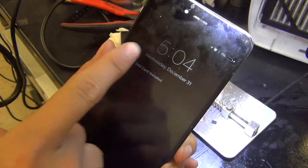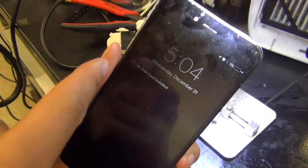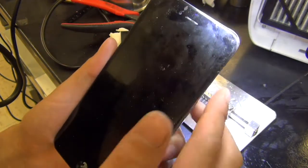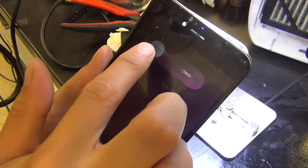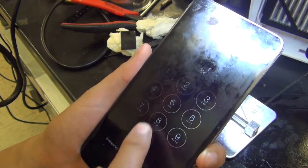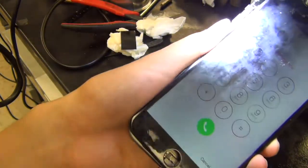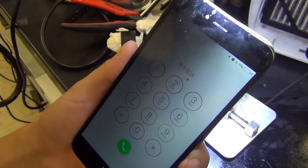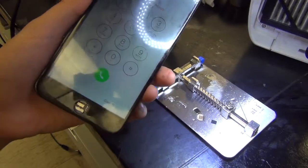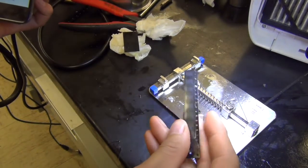By the way, the screen is a little bit dark on the side because this is my test screen — I use it so much I blew out one of the LEDs on the screen itself, not the board. So that's a non-issue with the actual phone screen, which is why it became my touch test screen. As you can see there are no lines on the screen anymore. There's no Z-bar line — and Z-bar line is a telltale sign of a touch screen problem. You can buy the touch IC for iPhone 6 Plus and 6 on my website as well. Thank you for watching — see you in my next repair!